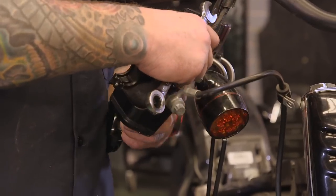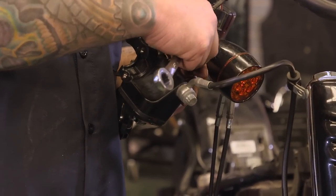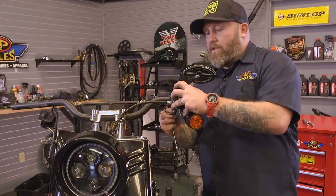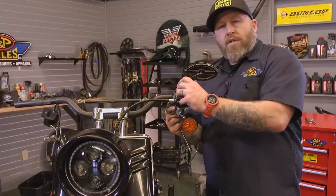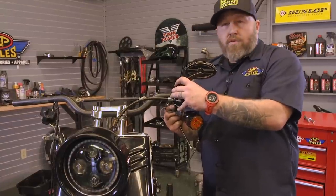Pulling our turn signal off here because the wires ran through the bars and it's holding us up from getting the master cylinder loose. So we're going to take our left control loose and get rid of our clutch cable. The clutch cable is a little bit of an involved deal, so we'll put a link in the description to a video on how to change your clutch cable. It involves taking the end of the transmission cover off and also includes adjustment.